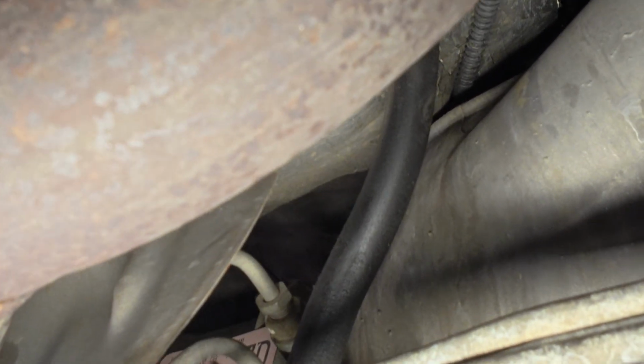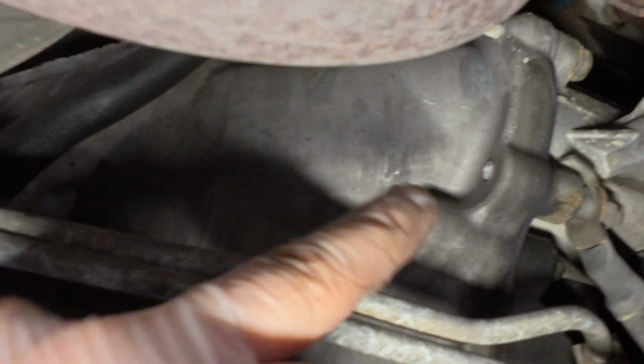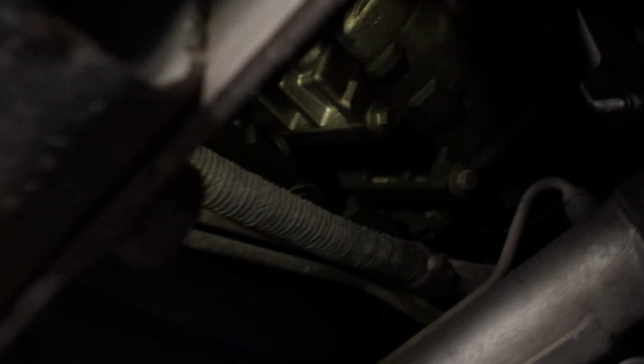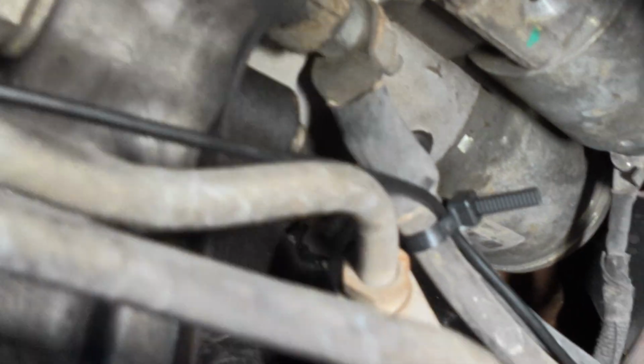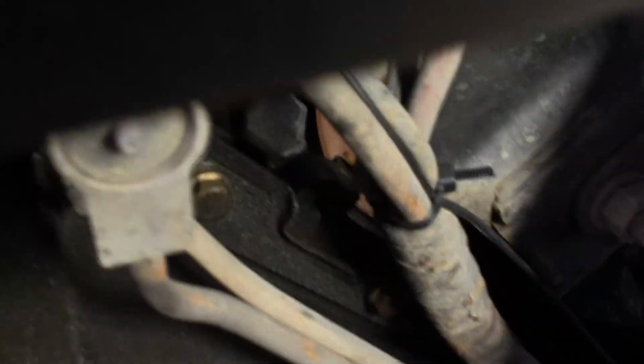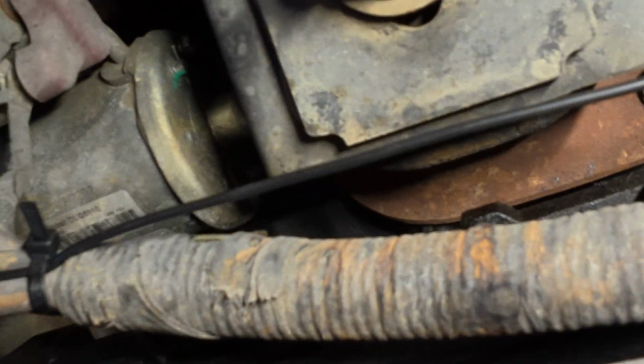We have some rubber hose that we're going to put around the wire to keep it protected. And then from there, we're going to come over straight across to this ground strap. We're going to run this ground strap as it goes up into the engine bay. Okay, started there, and hose our way forward. We secured some rubber to protect it. Pull clamps to the engine ground. Plenty safe, free hanging there.